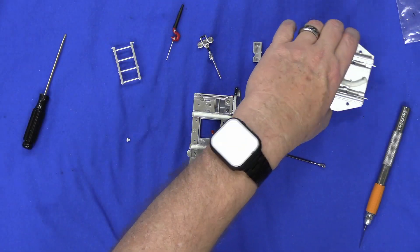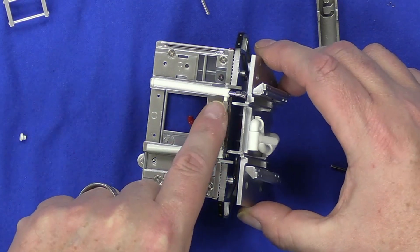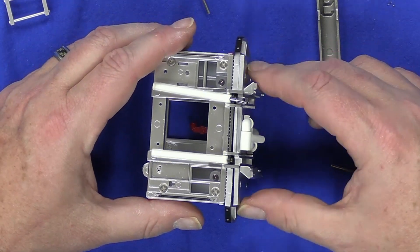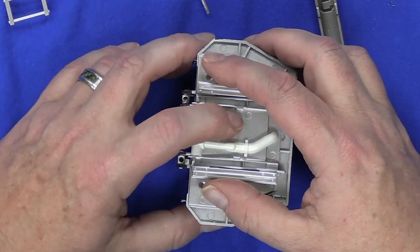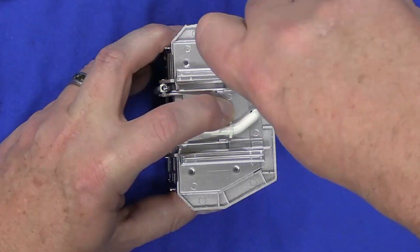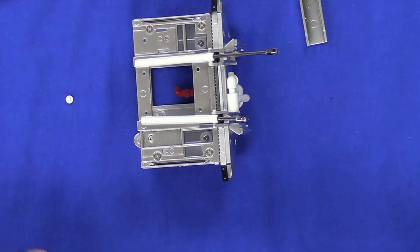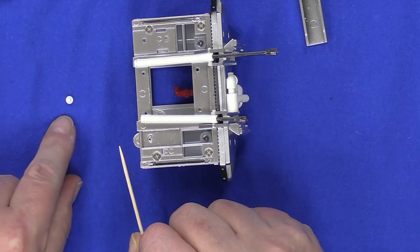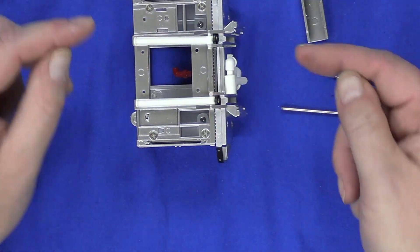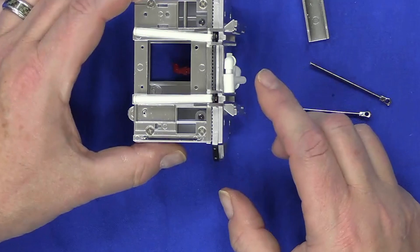Take the mini sub-platform — there are little grooves that are going to fit into the lugs sticking out of the pistons. Fit this onto here, then turn it upside down so the platform doesn't move. There are four holes — get some B screws for those. Now the piston is held in there. At this point I'm fairly confident we can super glue these end caps on. I'm not going to put the pistons back in yet in case there's any super glue inside that could seal the rod in place.